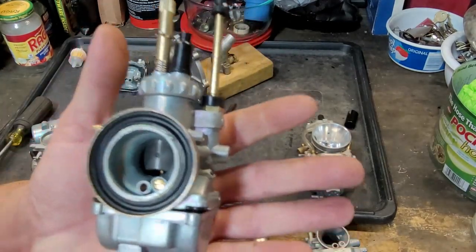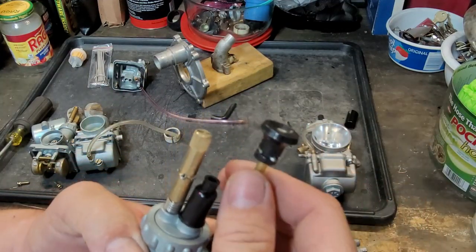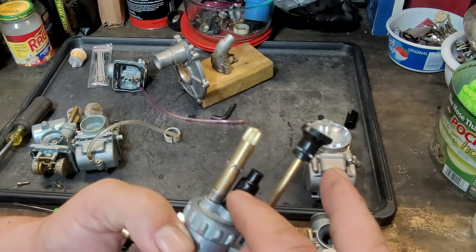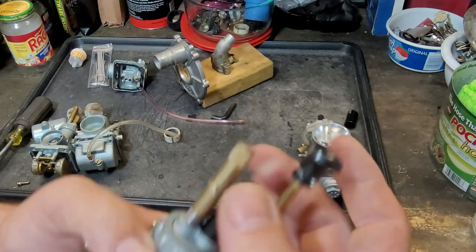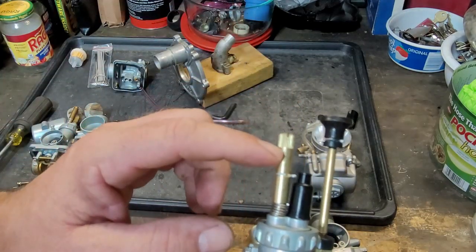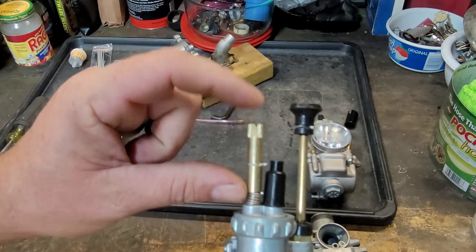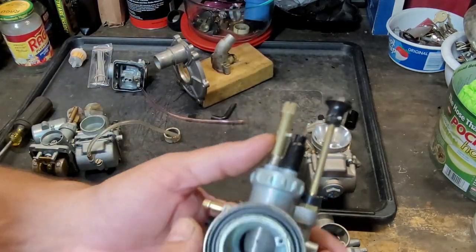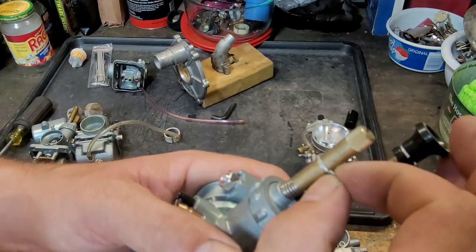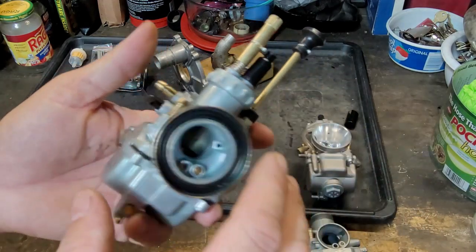We're going to take a look at the functions and the pros and cons. We have the choke rod with the new knob — it works perfectly fine, that's in the right place. Here's where your throttle is; it came with a nice little brand new rubber boot. This one right here is your throttle speed screw for your idle adjustment. I like this better than the factory one because this is all brass all the way down — the other one is short and takes a plastic cap which never really works too well. It's got a little piece here to hold it on.